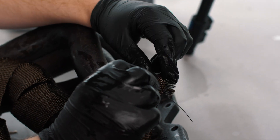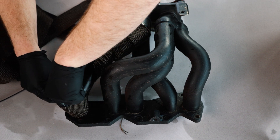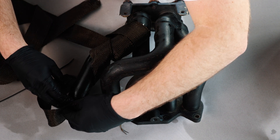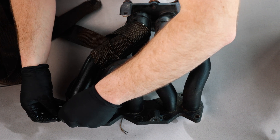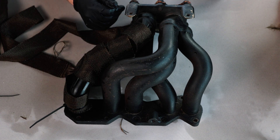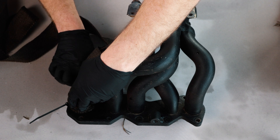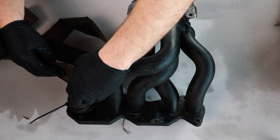Once this is all done that will hold itself nicely in place — this is just a way to try to get a nice neat edge. The first revolution you just want to get as tight as you can, and because the wrap is wet it's a little bit easier to mold and shape. Don't worry if it keeps rolling around the pipes; in time as you continue up it's going to get tighter. We're using plastic cable ties because they're easy to cut off and easier to work with. Continue wrapping from the bottom all the way to the top — the wetness of the exhaust wrap is going to allow you to get that nice and tight, and as it dries it will dry a little bit tighter.